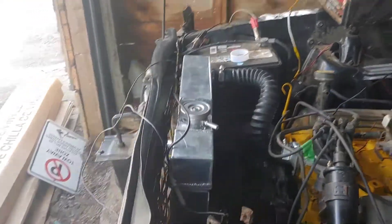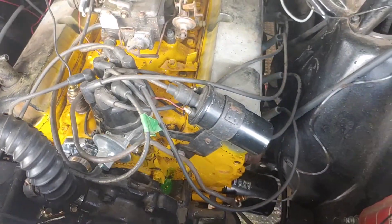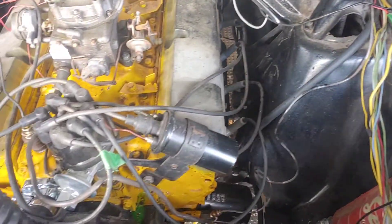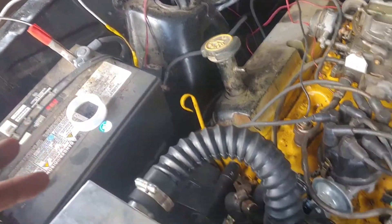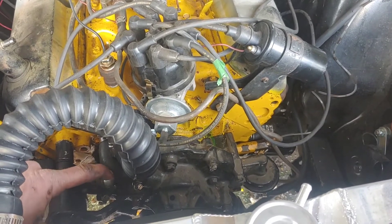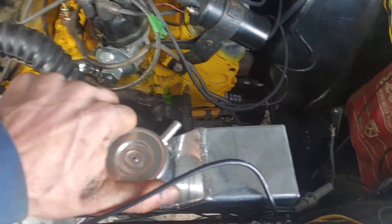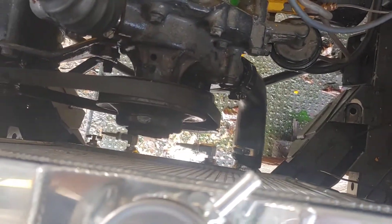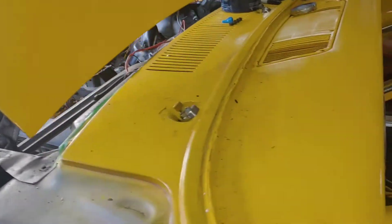Got all my coolant hoses on. I've been waiting for parts and things have really been on hold, but I just put some gas down the carburetor, got my hoses all hooked up, got my temperature probe hooked up, and all the various plugs I had removed are back in. Got the battery charging. The heater core pipe is just capped off with a wheel nut, so the coolant should be contained. I still have the old style valve covers and they're loose, which isn't ideal. Got the transmission cooler fittings in — you can see them down there, both going sideways. Let's see how this goes.